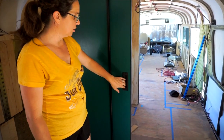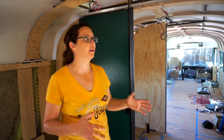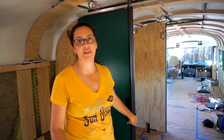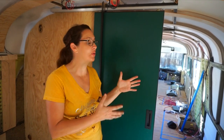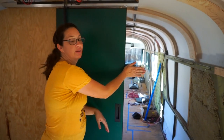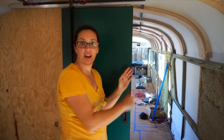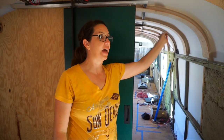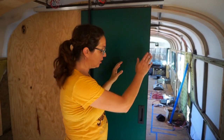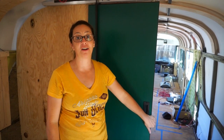We've got the handles installed to pull it open, and that's it. We're really happy with how they turned out — they definitely were a lot of work, but we're super excited with how they look and how they function and we think they're going to be a great addition for our bus. Now that the doors are all done, the reason why we did these so soon was because we needed them as a reference point to know where to build the opposing walls. The opposing wall here is going to be the mounting point for our bunk beds in the kids' room as well as the wall for our closet in the bathroom. Now that we know exactly where this lines up, we can get to work on building our closet — that's what's coming up next.